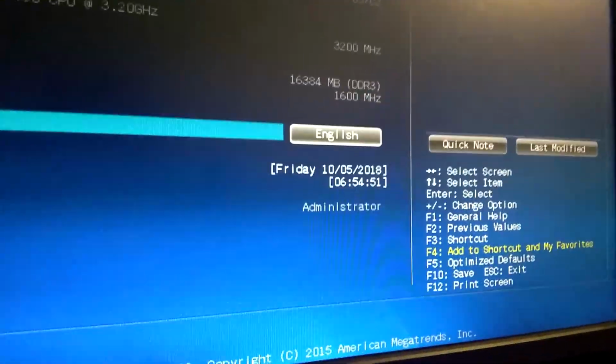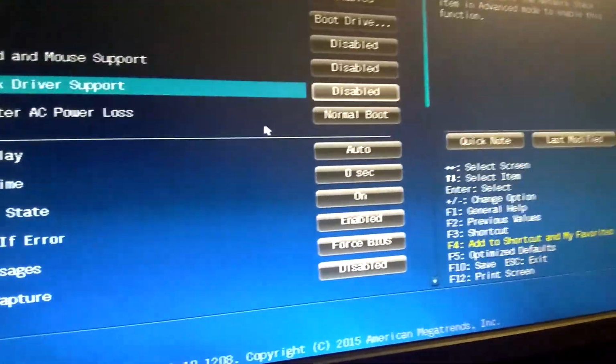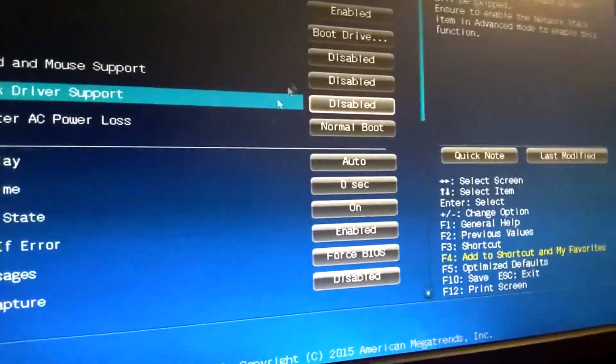And now we can press enter. But before that, we also have to configure this to actually boot into the new drive. I'm not going to do that right away. I'm going to temporarily make it boot in the new drive. Then I'm going to try to see whether I can use something like grub in order to make sure that I can easily switch between the two